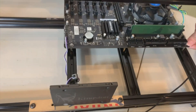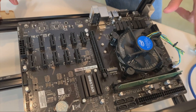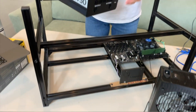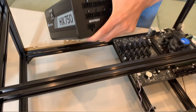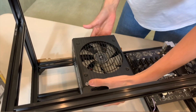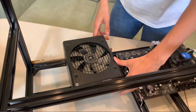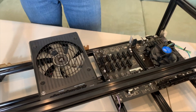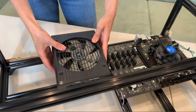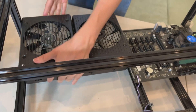First we have to connect our motherboard to the frame. I already installed the CPU, fan, and memory. Now let's install one PSU and connect the 24-pin cable and CPU cable to the motherboard. At this stage I always suggest checking if the motherboard will load, because if it doesn't there is a problem either with the RAM, memory, or CPU, and it makes no sense to move further. Now I'm stacking my second PSU.